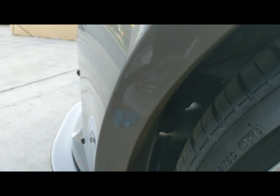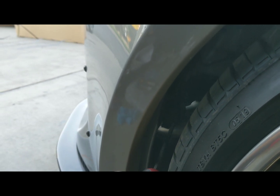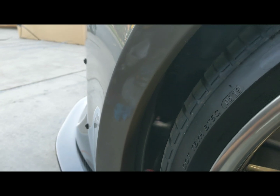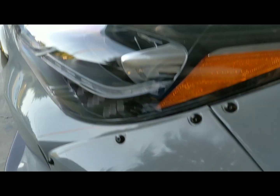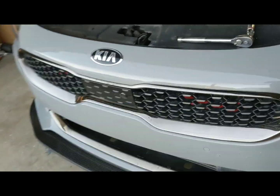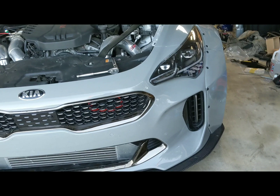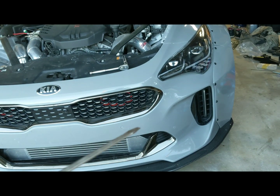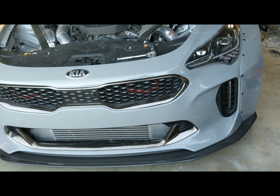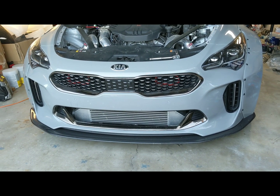but right there where the screwdriver is pointing, there is a clip that holds the wiring harness from the bumper, from the forward collision system and the sensors, to the rest of the car. So that needs to come off there as well. That's the only place where there's a harness, and that should pull the front bumper off entirely.